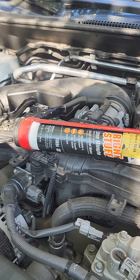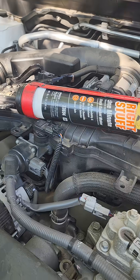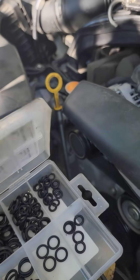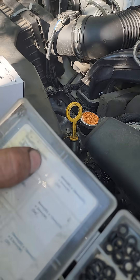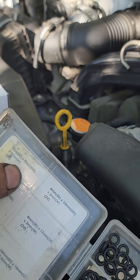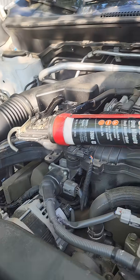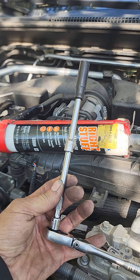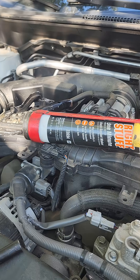Then I take my housing, which has two 10mm bolts in it, and I put the smallest O-rings from an O-ring kit from Advanced Auto Parts — it is a 5mm ID, 9mm OD O-ring. You put that on the bolts to hold them in place, and you take a 10mm socket on a quarter-inch drive with two extensions, and you can get it all back together.